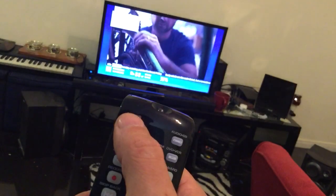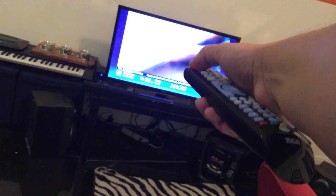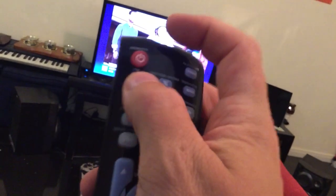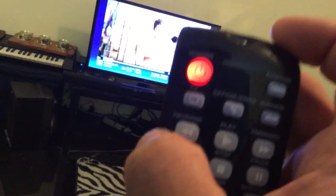Once it comes on, push stop to store the code — we'll see if the TV will shut off. It didn't. What you got to do is hold the TV button and the power button until the light on the power button is lit solid.